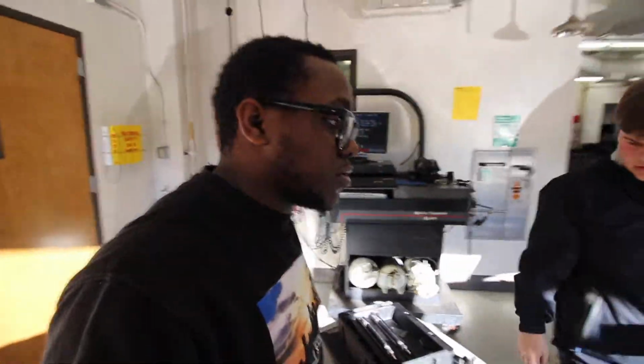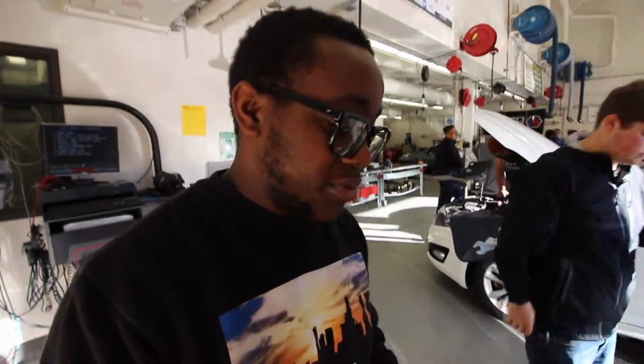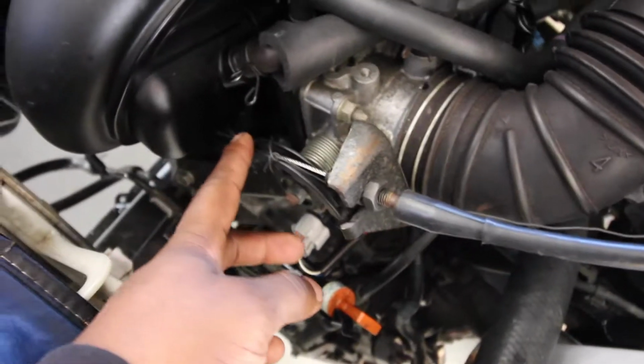All right, now. Oh, we gotta get rid of it. So after you hook up the gauge and everything, well, you're supposed to do it before you hook up the gauge, we have to block the throttle wide open. So I got some mechanics wire, and I'm just gonna tie the throttle plate so that it's open. It goes from here, wrapped to the airbox. My nifty job, you know what I'm saying?